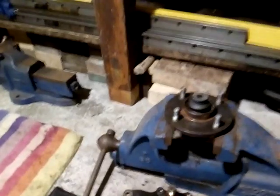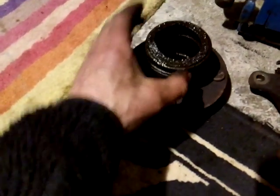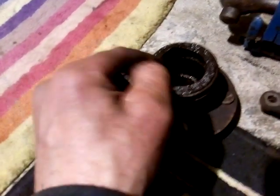That's a nice sound — that means it's moving. That sound means it's not moving; that means it's moving. Right, so that's out. That's the circlip that holds it in, and that's your ABS ring with a serrated edge that spins past your ABS sensor, which pokes through the back of your hub and reads it. That's not good — no problem, I'll get some new sensors.